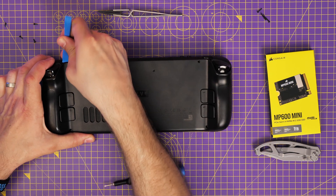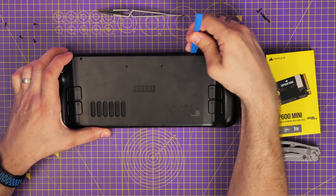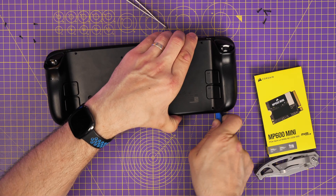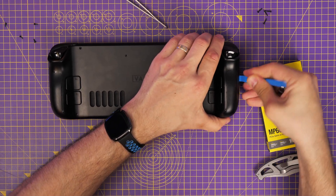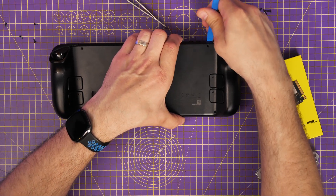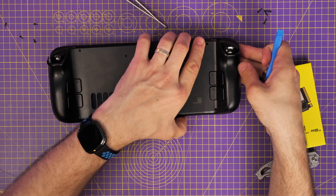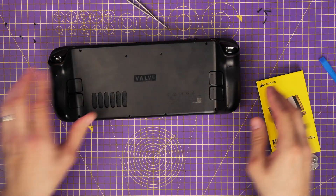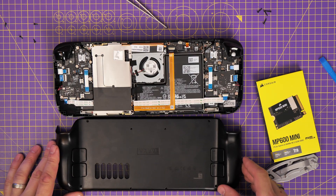The process for upgrading your Steam Deck and swapping out the NVMe drive is fairly straightforward. I'll link to a couple of articles from iFixit in the description which talk through the steps. It took me several hours to get this done and it is fiddly and nerve-wracking, because you have to be very careful — you don't want to break anything. You've got to tease the back off, removing multiple screws and using plastic clips to pull it apart very gently.